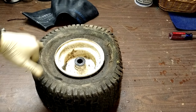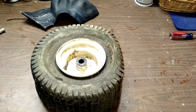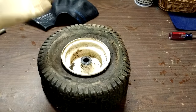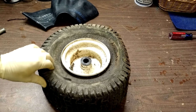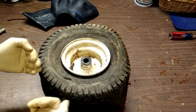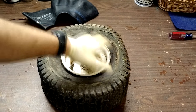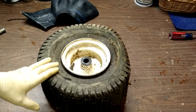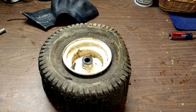Here we are with a very tired-looking tire. You can see that it's cracking around the edge here. Ideally, it'd be time to replace this tire, but it still has plenty of tread left. It's just old and weathered. So in order to save this, we're going to have to peel the tire off of the rim on at least one side, and that'll allow us to sneak that inner tube in there. It has a valve stem from the original, because it originally didn't have a tube. What we're going to do first is get a pair of pliers in here and cut this off.